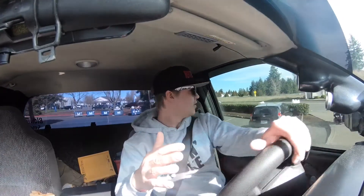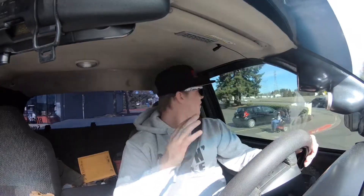I got a couple things I want to talk to you guys about and go over, and then the install on the truck today. I'm gonna be doing the clock spring — as you can hear, it keeps beeping and the airbag light comes on. I did some research online and it says the clock spring went bad. So I gotta get home, disconnect the batteries, leave it disconnected for an hour, then pull the two bolts from behind the steering wheel, take out the airbag, and replace the clock spring. I'll go over all that when I get home.